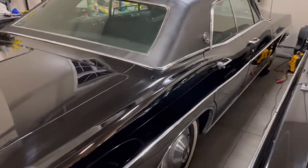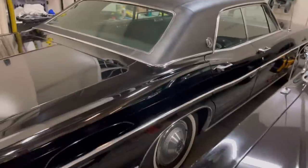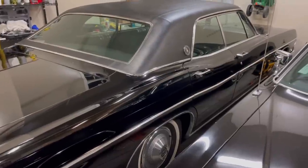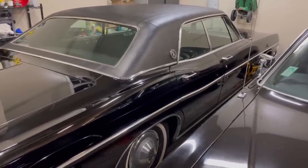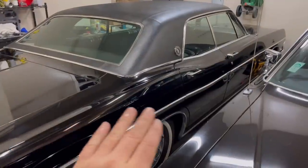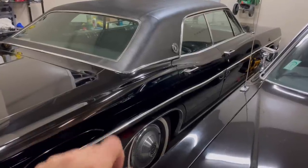There are really no burn-through marks on this side at all — somebody was a bit more aggressive on the driver's side, though it still looks good. One tip: if you get hologramming, especially on a black car — I hate black cars, they're so hard to get to look uniform. In natural sunlight it's one thing, but you really see hologramming when you pull the car out in direct sunlight. After you do the rubbing compound and machine polish, you're going to still have some light hologramming. What you do is, toward the last bit, you start pulling up on the polisher to take the weight off.